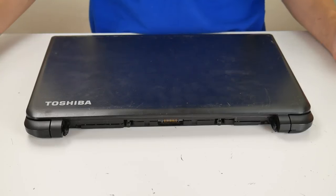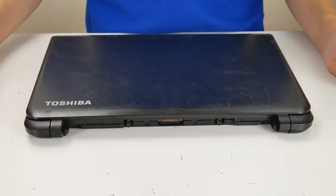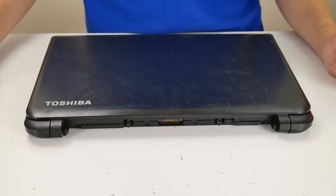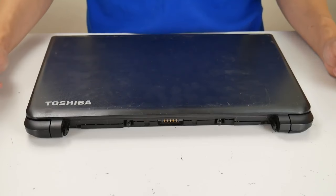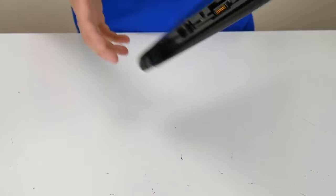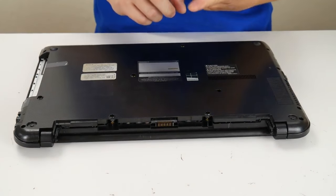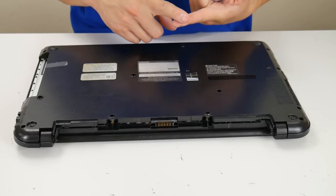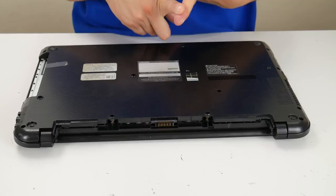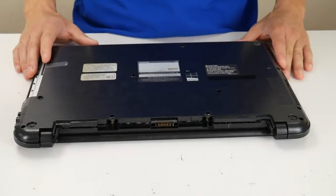Among other reasons for needing to do a BIOS reset, this is one of the steps in a diagnostic process trying to figure out why your computer is either not starting at all or if it starts part way and then shuts off. If you are going through your diagnostic process with that issue, the first thing you would want to do is test your adapter — there will be a link to a video showing you how to do that. Then you would also want to check your power jack and your power port on your motherboard if your adapter checked out. There will be links for those videos as well.